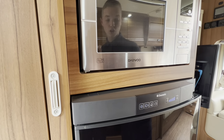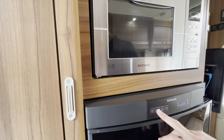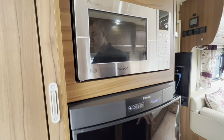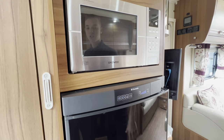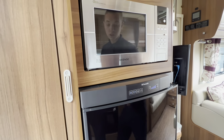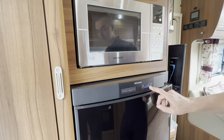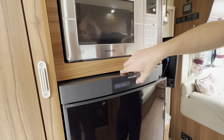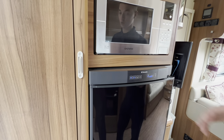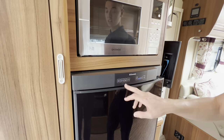If you're lucky enough to keep it at home, a few days before you'll want to hook the caravan up — it'll give it a good chance to fully charge your leisure battery. You'll also want to put your fridge on mains, allow that to chill at full temperature. The night before — or the day before — load your fridge with the shopping you need for your trip, allow that to chill for a good 8 to 12 hours, and then when you're ready to tow it, put it onto battery, lock everything up and drive off. Once you've got your shopping on board when pre-chilling, turn it down to 3 or 4 — otherwise setting 5 can sometimes freeze the shopping in the fridge. When you're not using it, simply turn it off and leave the door open. So: mains when on site or pre-chilling at home, gas if wild camping with no electric hookup, and battery when towing.